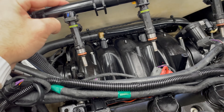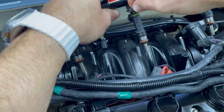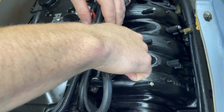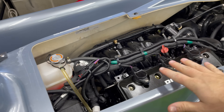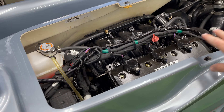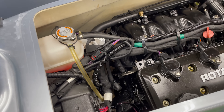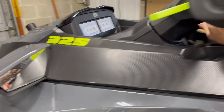Let me go ahead and do these other ones. We'll do the middle here, make sure it's all the way in and facing forward. Everything is back together now. And if you remember from my last video when I was doing the injectors, I mentioned doing the fuel pressure test to make sure none of the injectors or anything are going to leak. So let's go ahead and do that now — it's very easy to do. Just put the key in your ski, go ahead and wake it up. We're not going to start it, we just need to wake it up. The fuel pump is going to kick on, and that's it — we're up to pressure. There are no leaks on any of the injectors, which is good. Leak test is finished.